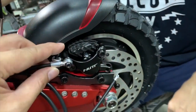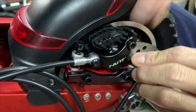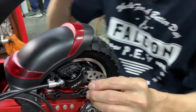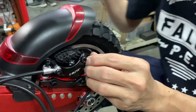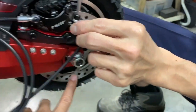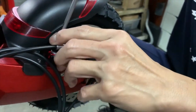The Nutt brake caliper should just fit in easily with the existing mounting, so you should be able to use the same washers to fit it on. The washers are just to adjust the height. If your disc is 140mm you shouldn't need any additional spacers, but if you're using a larger 160mm brake disc then you might have to add a few washers.